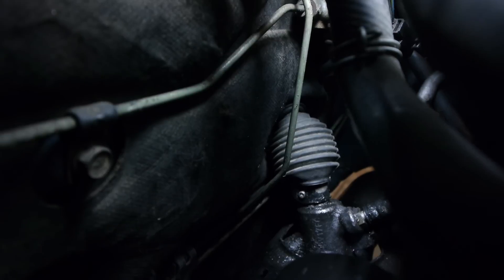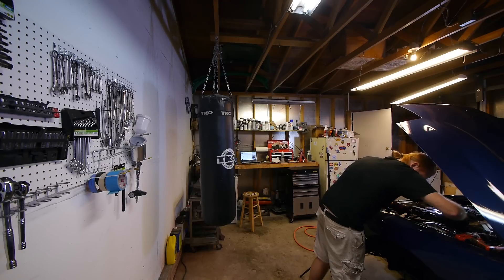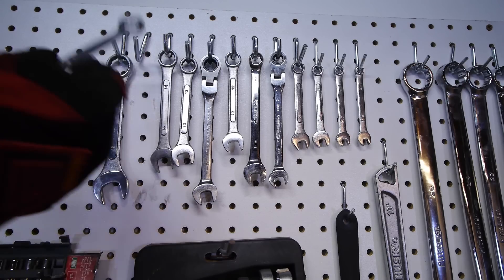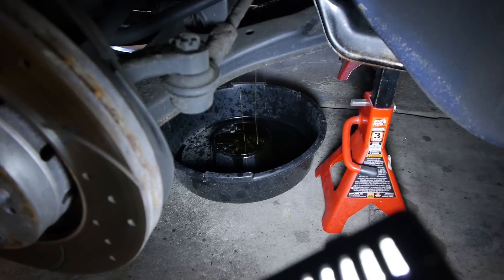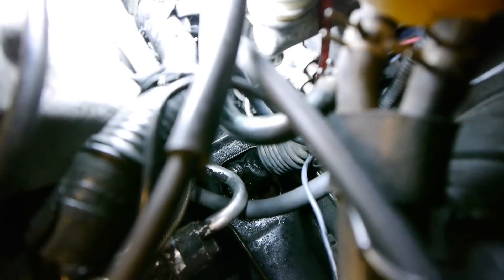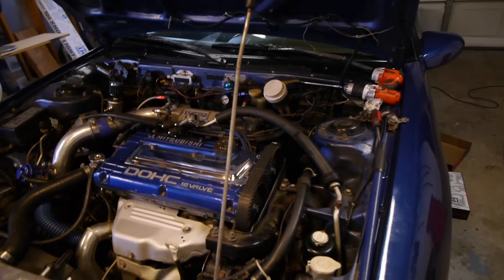Here's a shot from the passenger side of the car, and you can see what we're working with. The first one is a 12 millimeter that holds the shaft to the spline on the rack. Next is the 17 millimeter lower power steering line bolt and the hose next to it. Get those lines disconnected and then make sure you have an oil pan ready. Now that we have all that disconnected, you can see the top part of the rack dripping fluid all over the place — when you're making a mess, you're making progress.